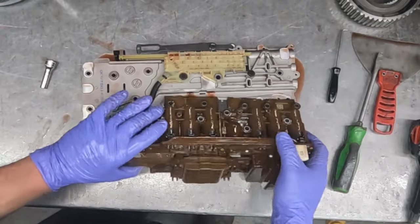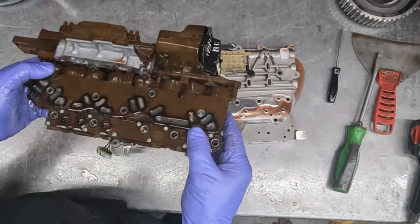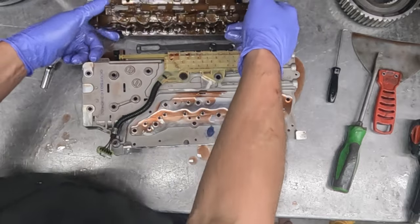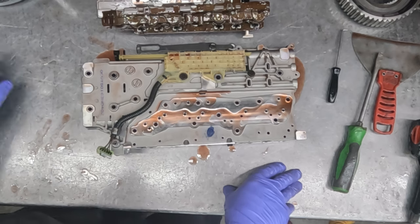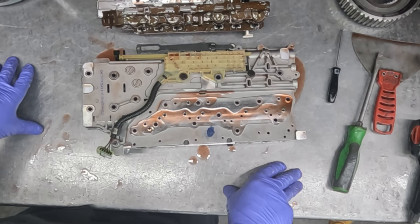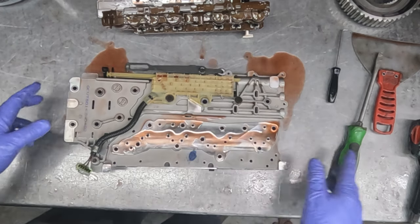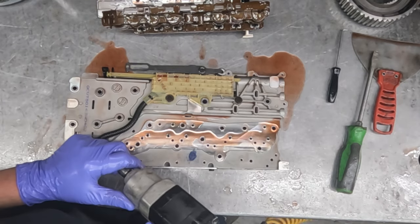A lot of shops might sell a TECM on every rebuild, but here at my shop, I don't think that's necessary. Not until you get to maybe, in my opinion, 120,000 miles. After that, I think there's a reasonable expectation that the TECM might not continue to live a normal life after rebuild once you're over 120,000 miles on it.